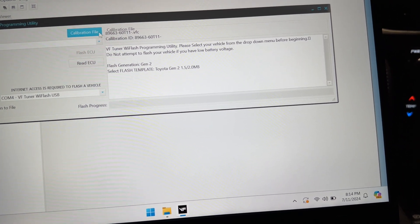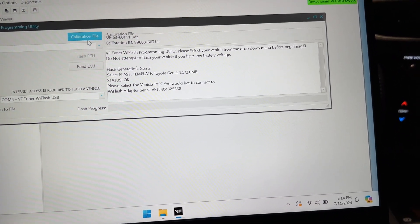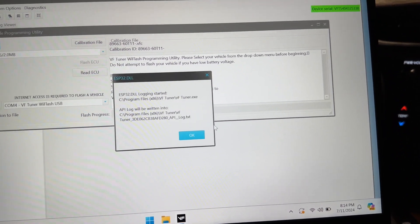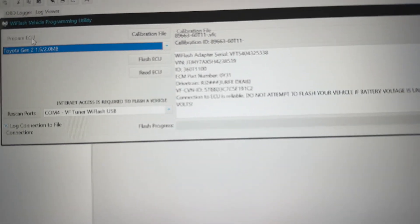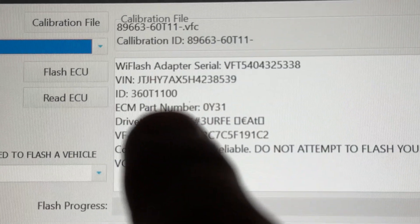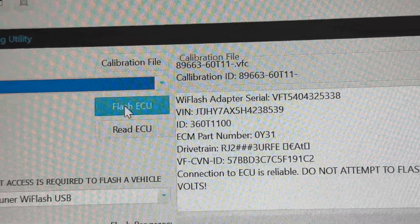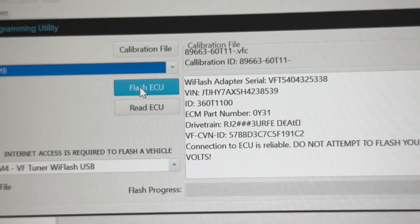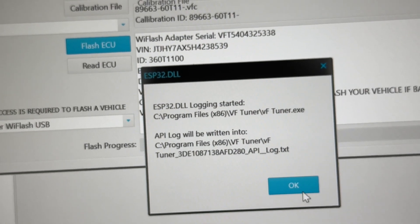I'm out a few hundred bucks and hopefully that video is helpful and entertaining to some of you guys. Link will be down in the description if you want to go view that. Now what we're going to do is flash the calibration file that comes with the VF Tuner software. You've got to find the one for your particular ECU — and that is this guy right here: 60T11. That is the calibration file with the correct ECU ID. So what we're going to do here — I've got that uploaded. We are going to Prepare ECU. Hit OK. Select Toyota Gen 2. I guess you've got to select this first from the drop-down, then Prepare ECU. Now Prepare ECU is grayed out, so that means we're good to go. We've got our ECU ID right here — 60T11 — and our calibration file is 60T11. So that's the right one. Now we're going to cross our fingers, pray to God that this works, it doesn't brick the truck, and we're going to flash the base calibration file. Click. OK.